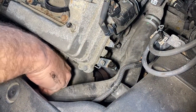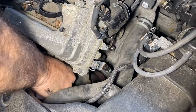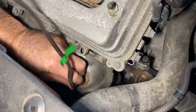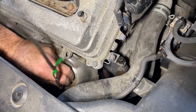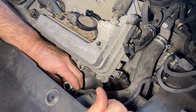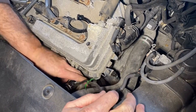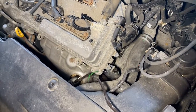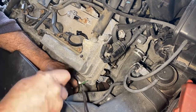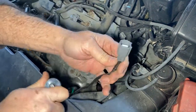Don't plug it in before you screw it in, because you've got to pivot it. Start this by hand — just pivot it around like that. Once we get close we'll tighten it with a socket. Slide this down like that, put the swivel on here, and tighten it up. Make sure you don't plug it in yet because it can turn quite a few times.